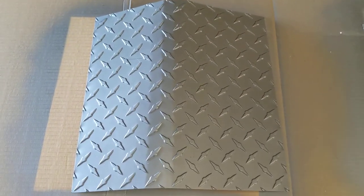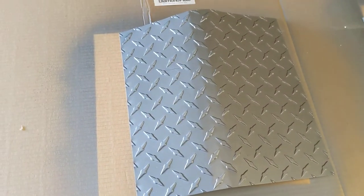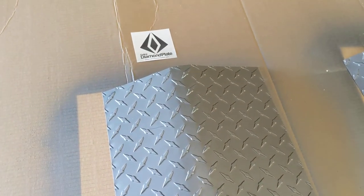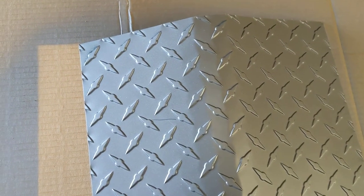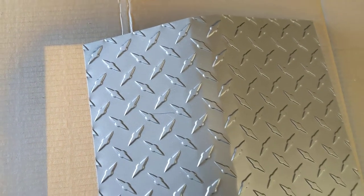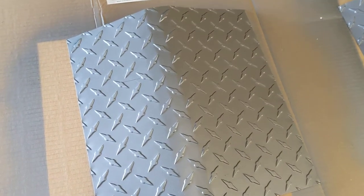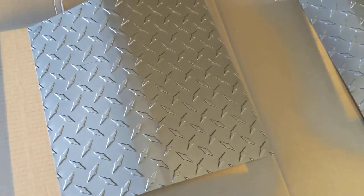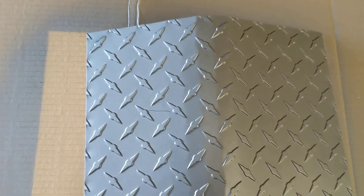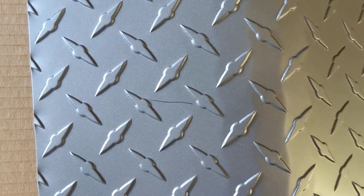Still black underneath. So there you have it. I would say that if you're going to use a dark color — maybe most colors — you're going to be seeing that if it gets scratched. It's not quite as durable, the spray paint, as the factory applied paint on our diamond plate. But it looks like it's going to hold up good. It's not going to crack. The only thing is if you get scratched, it scratches a little easier with the spray paint.